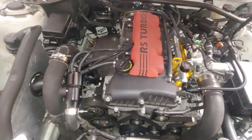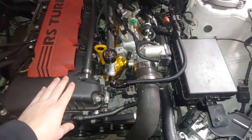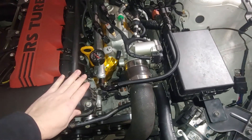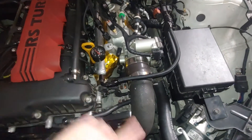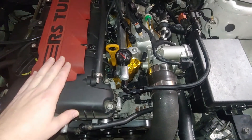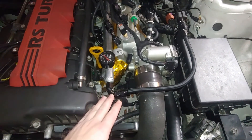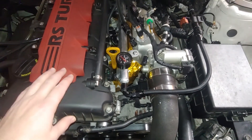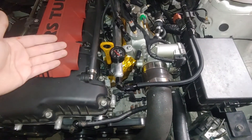The last thing I don't think I discussed so far is that getting rid of this tube basically eliminates a source where you could potentially get any oil blowby through here. And yes, I get that if you run it into a catch can and then run it to here, ideally you shouldn't have any that's in there. But it also prevents any potential risk of leaking boost back through here, because one thing that engineering teaches you is that there's no such thing as a perfect seal.